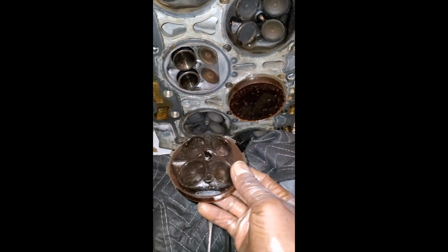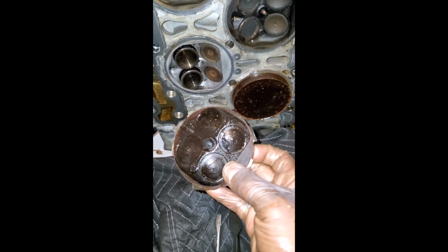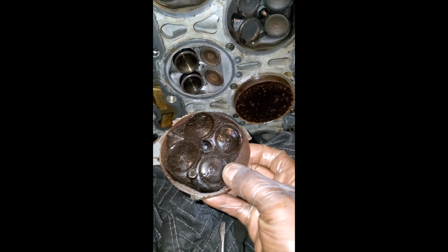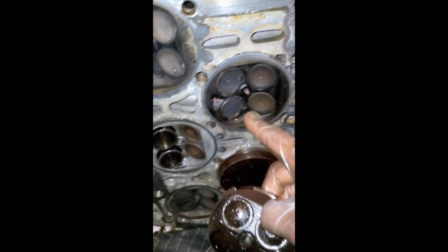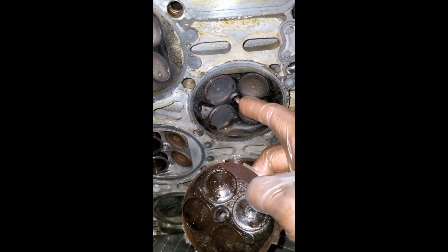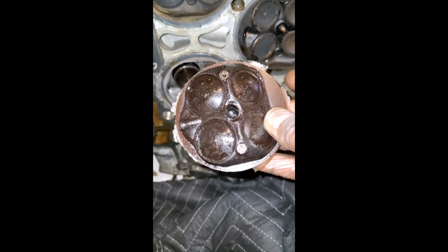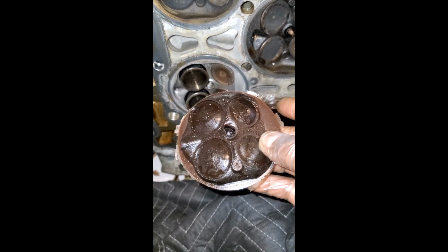It's turned out great. I just had to use a flat tip screwdriver and pry just a little bit, and it just popped right off of the valves. So this looked pretty good. You can actually see where the epoxy itself started to penetrate the cylinder bore. But what I did was use a rubber plug and measured how far the spark plug protrudes into the combustion chamber, and I used a rubber plug in these two cylinders and measured it at the same distance that this protrudes, and that way it has a nice shape in there, and they can cast the racing pistons for the fill bowl in a proper location.